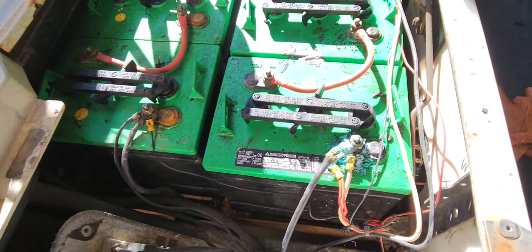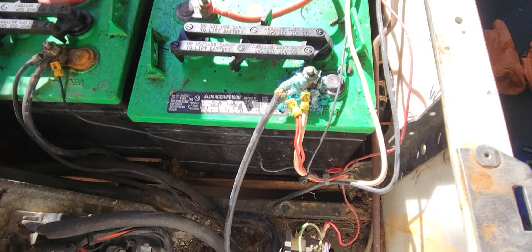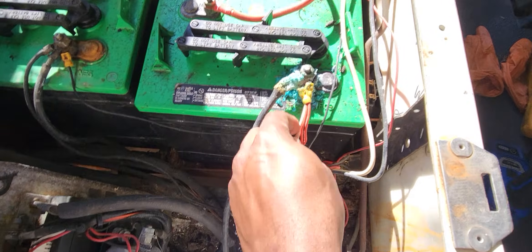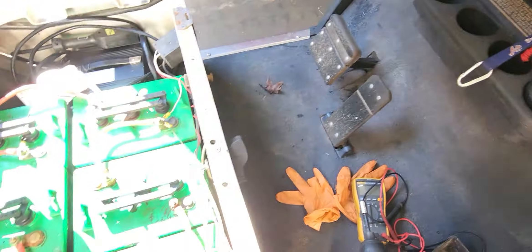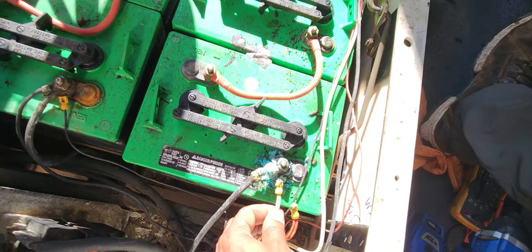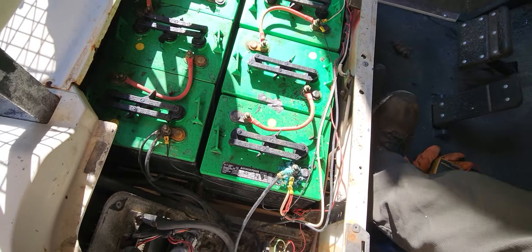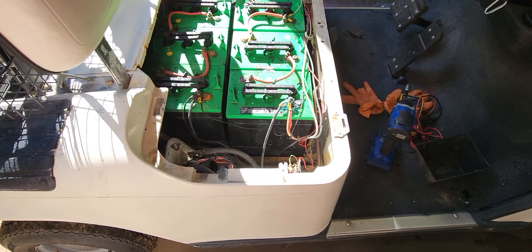We always need a platform to start with, and we can see this wire is broken, so we need to start there first. We're going to try something: make sure the key switch is on, then press the pedal — I'm just going to hold this wire terminal here and see if it tries to go. That's it — it tried to go. That's literally all that's wrong with this golf cart. The guy brought it in, didn't know what was wrong, and that is literally all that's wrong with it.